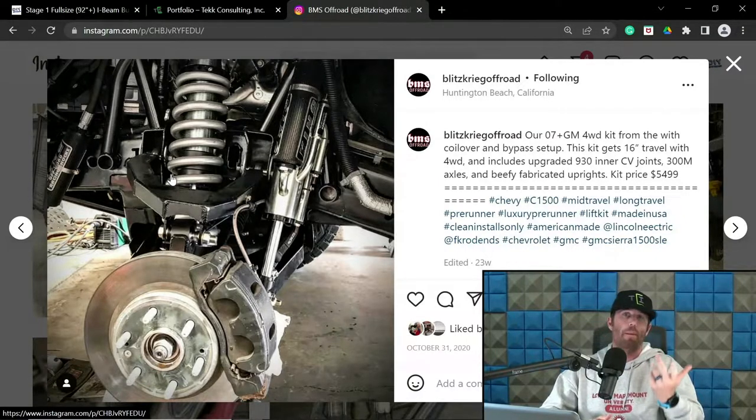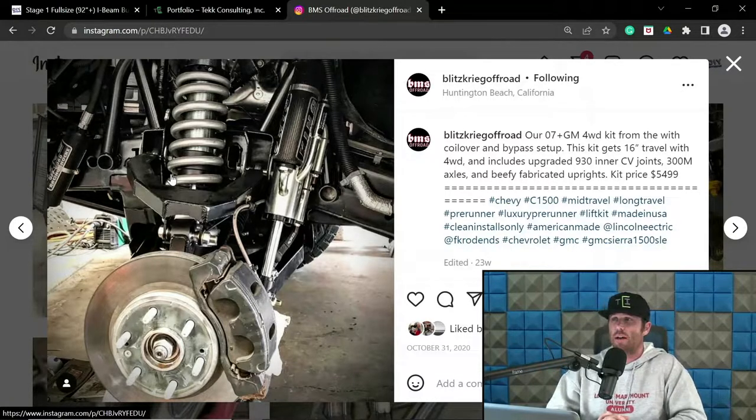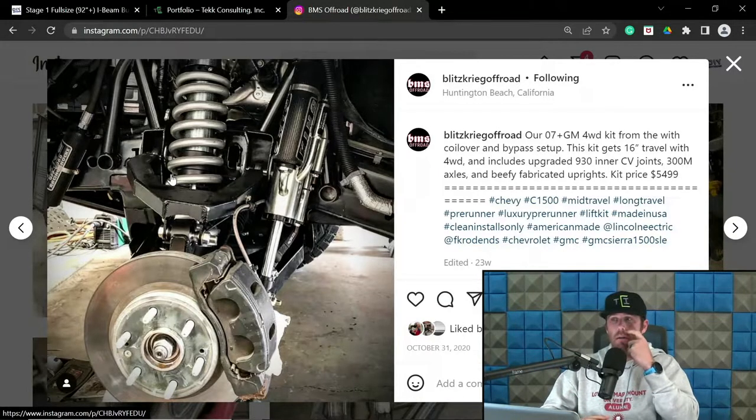Now, also that wheelbase addition can be beneficial in a few other ways. You can also start to add some Ackerman into the system, which can be beneficial for these trucks, because typically these stock trucks have not the greatest steering to begin with. And it could also bite you if you add way too much Ackerman. So another tactic you could use is if you were to remake lower arm mounts, etc., and slide the assembly entirely forward, like the steering rack, etc., for all of the bits. So you're basically taking that entire bulkhead chunk and sliding it forward in the chassis. So that's another tactic you could employ.